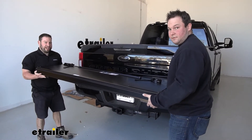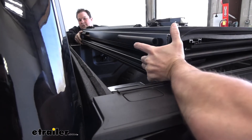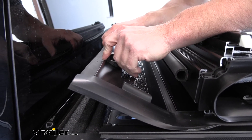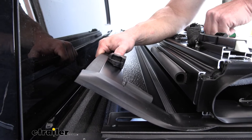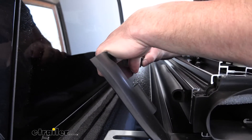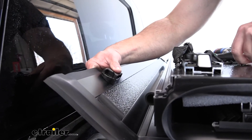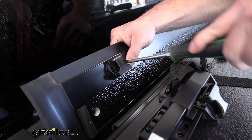The last part you'll need a second set of hands — Jordan's going to help me lift the cover and set it toward the front of the truck. We'll drop it into place and then put our clip in. You can do that before you lift the cover onto the truck bed, or do it now — it's just as easy. Line up the clip facing toward the back, use the insert underneath, and go up through the pre-drilled holes in the tonneau cover. If the holes are slightly off, you might have to drill them out. Then add the screw in from the top with a screwdriver.